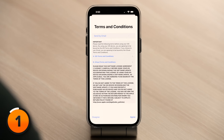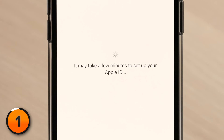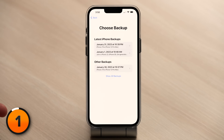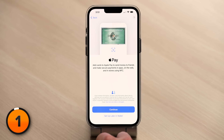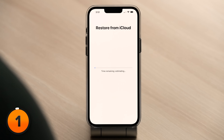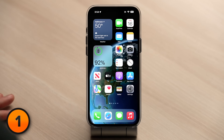You'll see an Apple ID verification code prompt — you must find another device. You only see this pop-up if two-factor authentication is on, which it probably is. Read the terms and conditions start to finish, then tap Agree in the lower right-hand corner. It may take a few minutes to set up your Apple ID. On the Choose Backup page, choose your most recent backup. Tap Continue to make this your new iPhone. Set up Apple Pay and other options later. Once the restore from iCloud completes, you are back into your phone with all your apps restored thanks to the iCloud backup.